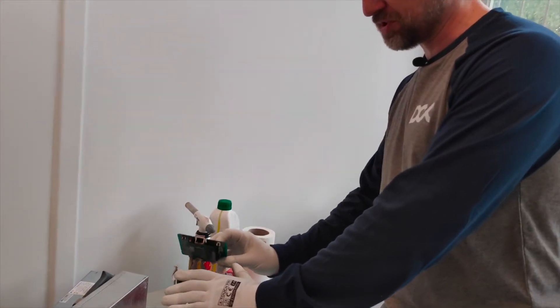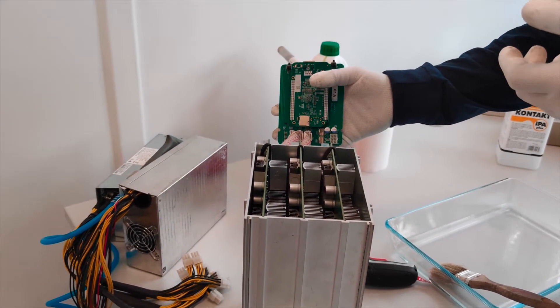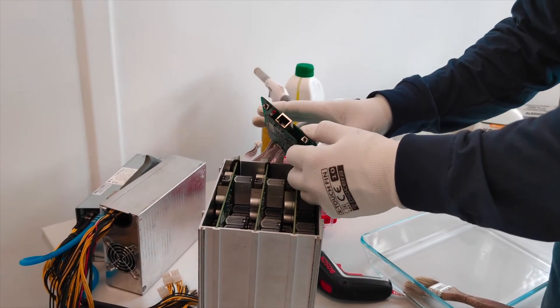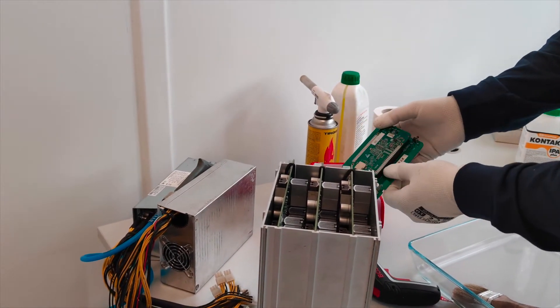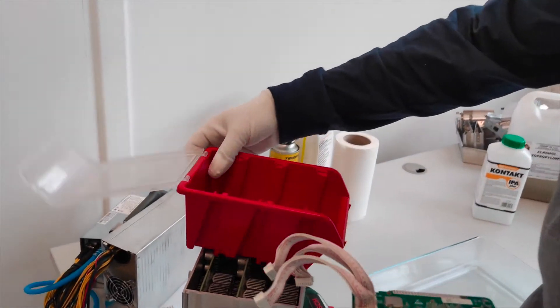What you'll probably ask about is the firmware. Some miners will have firmware provided by overclocking experts who have an immersion version — there are already three to five different immersion firmwares available. You can also take firmware directly from the manufacturer. For example, Whatsminer provides a free immersion version of their firmware — you just give them a waiver and they provide it. It doesn't allow overclocking, but it will work perfectly at no cost. If you don't have any custom firmware, you can use something called a fan spoofer or fan emulator.